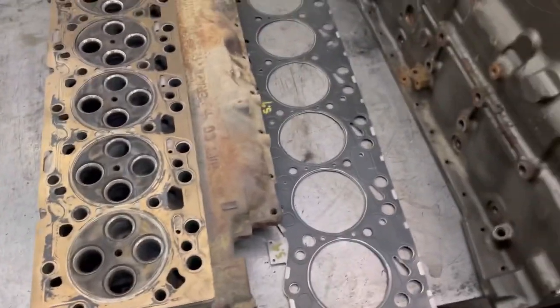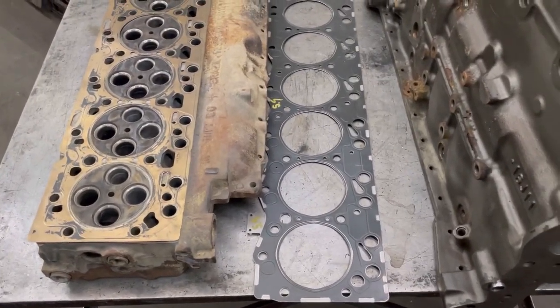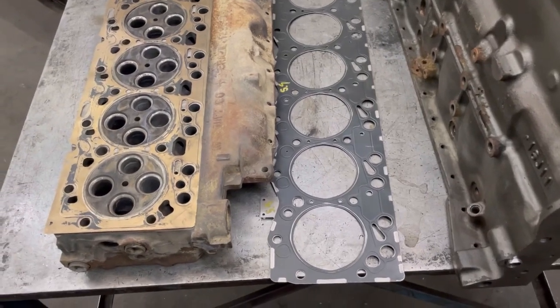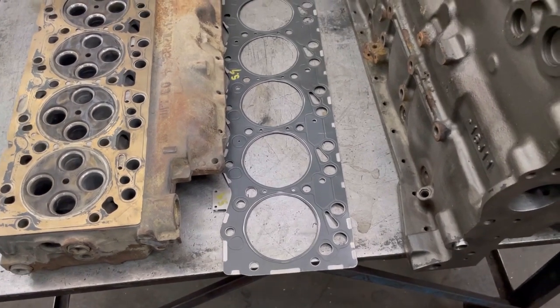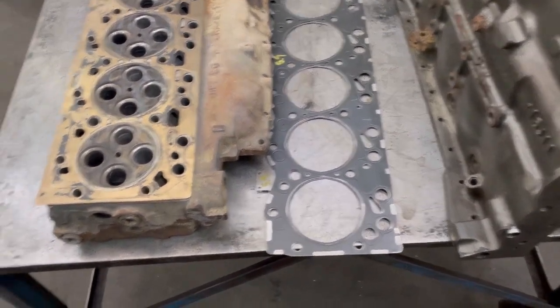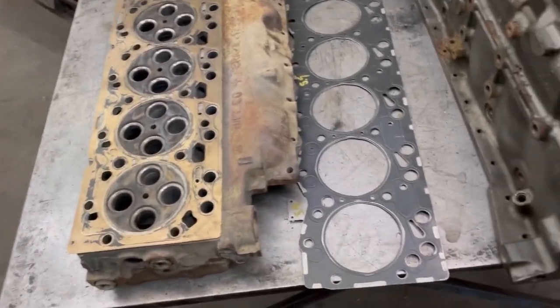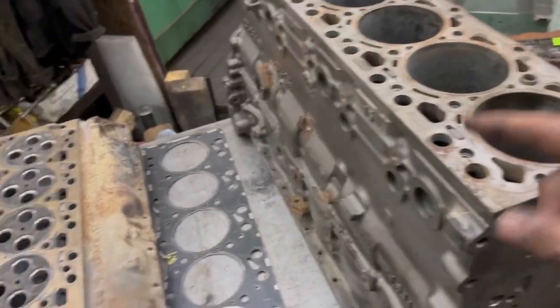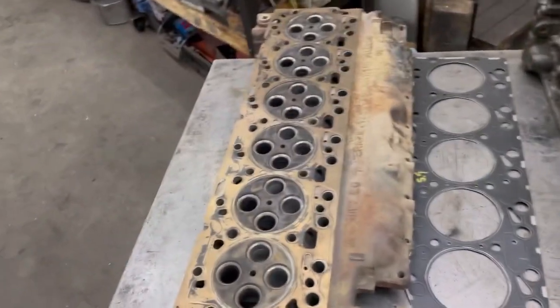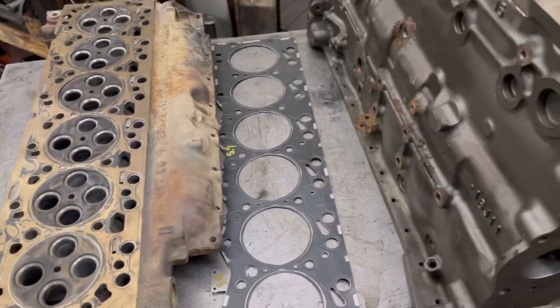If you're stopping that flow — I have done this both ways, to each his own. I don't know which is better, to be totally honest with you. Obviously more flow is better, but I'm kind of on the fence on that one. So obviously if you're using the common rail 5.9 head, I personally would drill holes — that's what I have been doing for a while. On my race truck, which has a 6.7 block and a 12-valve head, it does not have them drilled. I've not had any ill effect of it yet, but that's one of those things — we haven't run it super hard yet either.